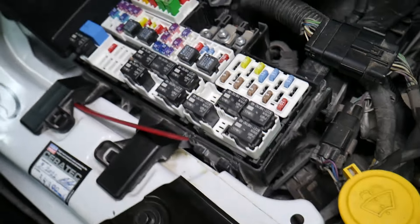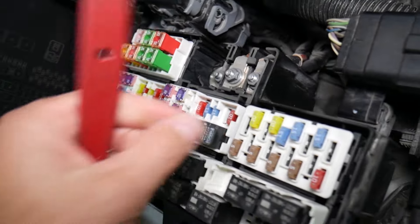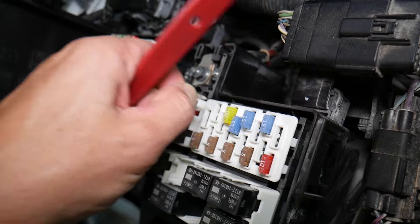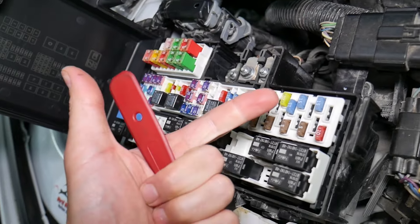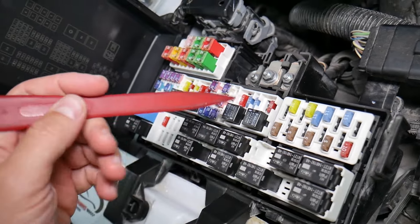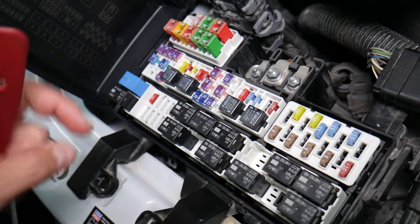Before we continue, let's explain quickly why it's always a good idea to test fuses and relays. It is very important to test fuses and relays — on those fuses you cannot clearly see if they're burnt or not, especially on JK-type fuses. If you remove a fuse, look at it, and assume it's a good fuse, but it's actually a bad fuse — sometimes you cannot clearly see that. What can easily happen is you put the bad fuse back in and start replacing parts that you don't need to, losing time and money. We'll put a link to a special video that will teach you how to test fuses and check relays very easily. Check it out — it will be in the description of the video below.